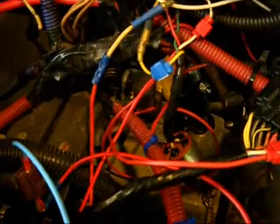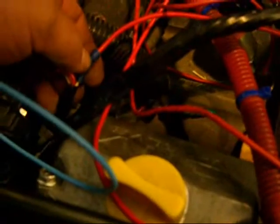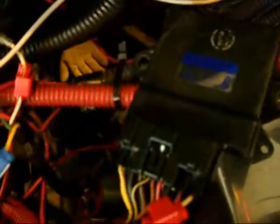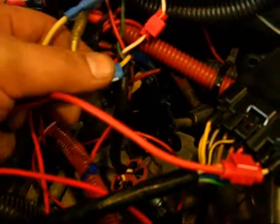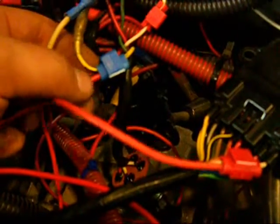I won't put liquid seal tape on these things — I'll put silicone inside these joints so air doesn't get inside, to keep it dry for a lot of years. This ground right in this Packard connector, that top terminal — very important. Right next to it is the white wire, which was going to the computer too, and it had to be run off another key-on circuit. So what I did is I tapped onto the other key-on circuit that powers up the dash lights, which still gave me the key-on power. So when the ignition switch is on, I get power going to this connector.